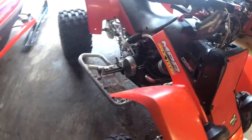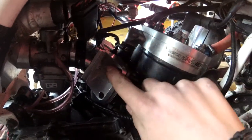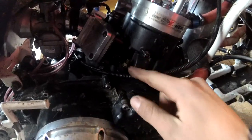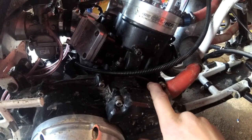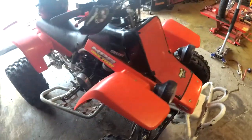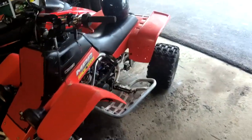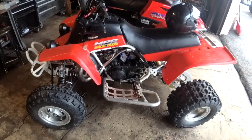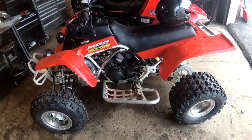Symptoms of an air leak — you really need to be worried about air leaking in. I have a single carb on this, but air leaking into your intake gaskets, your base gaskets on a two-stroke, crank seals, all that — it can cause high idle, revs taking a really long time to fall back down. In my case, my symptoms are I have a really huge main jet, really huge pilot jet, and needles all the way rich on the carb just for it to run normal.